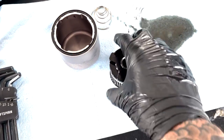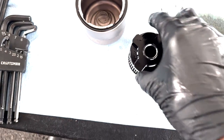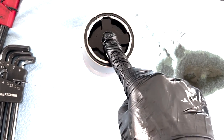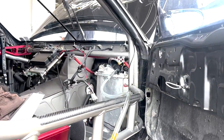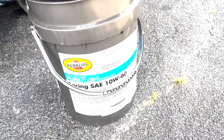Now we're doing an oil change. Since it's a dry sump we spin the dry sump pump with the tank open to get all the extra old oil out — we put a little Milwaukee drill on it and spin the pump slow, pushing all the old oil out. Then we take apart the super cool reusable oil filter, clean it — it's got a magnet on the bottom that catches any debris — clean out the canister and put it right back together. Then we get our big bucket of Pennzoil racing oil and pump it into the dry sump tank using a pump attached to our five-gallon pail, since the tank is right up against the firewall. Then we go for a test drive to make sure everything's working.